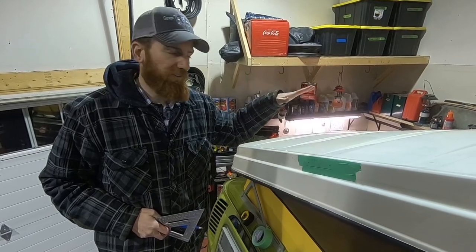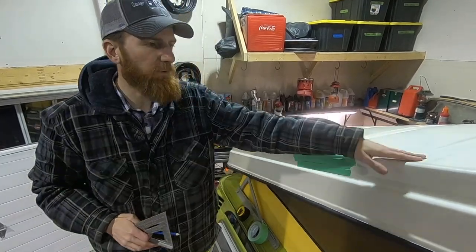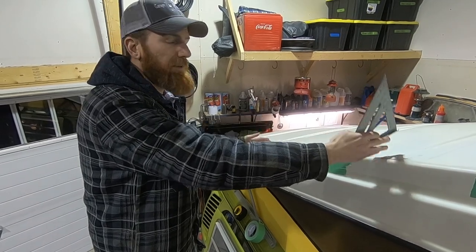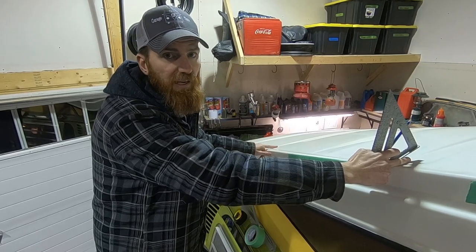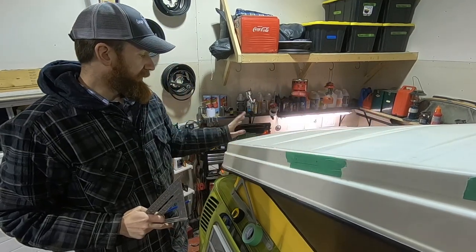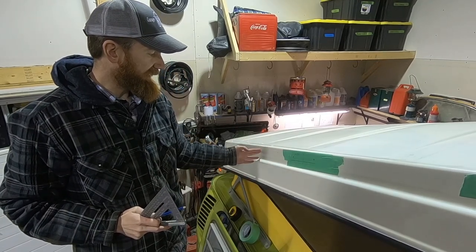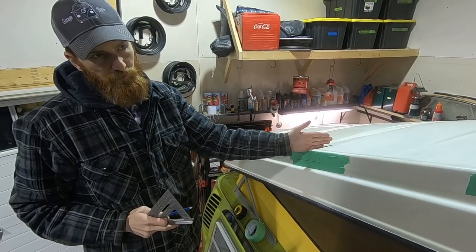Like they say, measure twice cut once. We went underneath after we popped it up and checked — we did want the brackets to be here and here. We're using the roof grooves as our guide and they're giving us the distance we needed for our rack. Based on our cargo box, the maximum we could do was 36 inches, the minimum was 22, and the center-to-center of two grooves is 28, so it works out pretty perfect. When we popped it up, the roof mechanism — you can see the three bolts — does cover this whole area, so putting our first bracket there would interfere underneath, causing problems, so we've moved it up one groove.